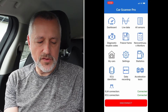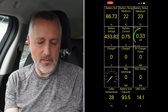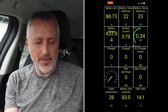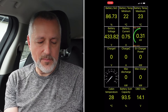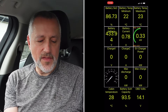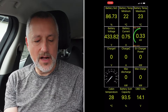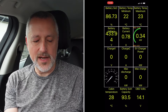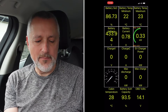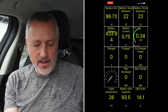You get a menu, and at the top left-hand corner you go into the Dashboard. You've got 13 different screens you can skip through, and you can also customize them. The main screen has really useful information: top left is battery state of charge, then battery temperature — which is really useful because under 20°C you get much lower charging speeds, and between 20–40°C you get much faster speeds. You also have battery voltage and battery current.